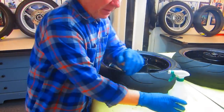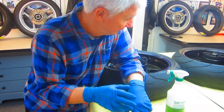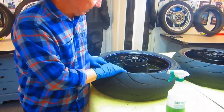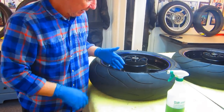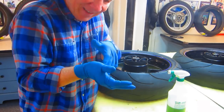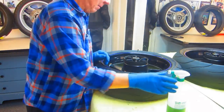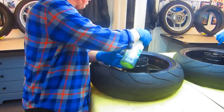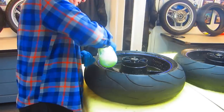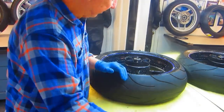The one thing you never want to do — and it's really a never thing — is take a wheel like this before it's been cleaned and take sandpaper. Because the sandpaper grinds the silicone, oil, grease, and wax down into the paint, and then you have a fisheye issue that lasts forever. The best thing I've found is, before you even look at a piece of sandpaper, get this clean with any combination of cleaners. Simple Green just happens to be one good one.